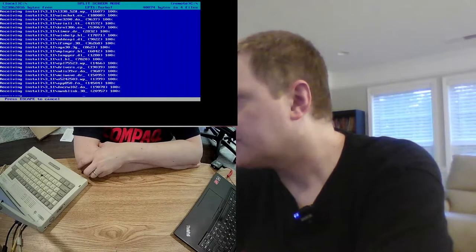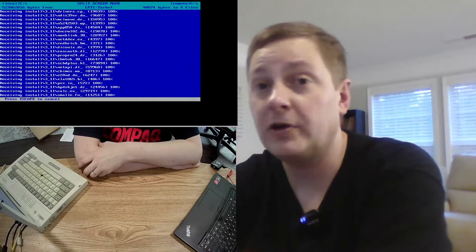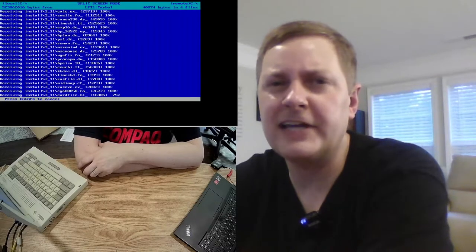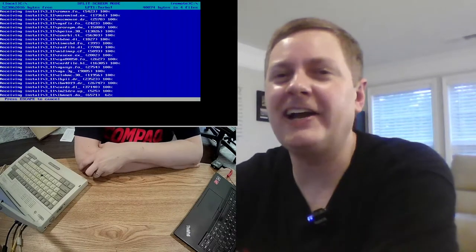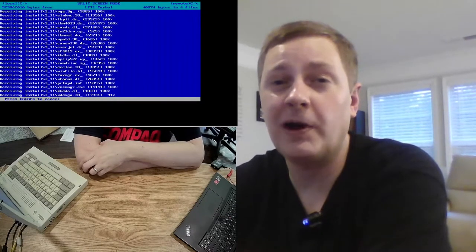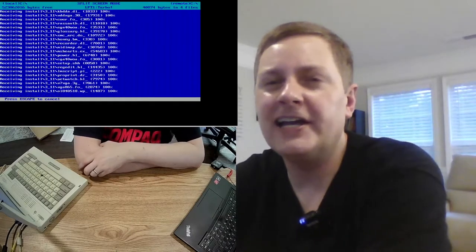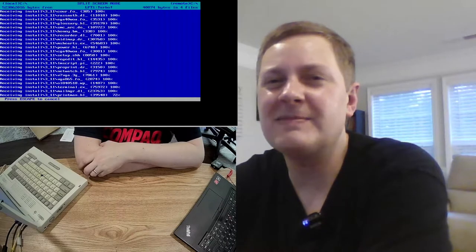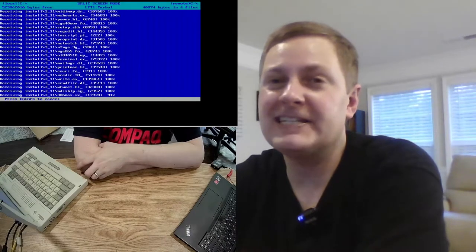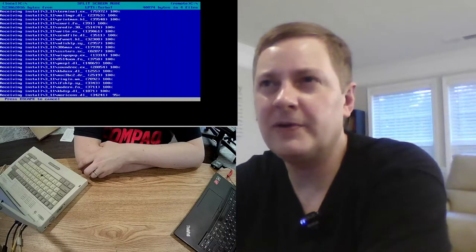So, yeah. Marco CS, trying to network an IBM PS/2E with DOS 6.2. I forgot how many options were available with protocols. Oh, yeah, tons. I think I have a setup video on LANtastic. The key thing that I found with LANtastic in setting it up was that you had to connect into a wired network because of the way that VirtualBox simulated packets. It seems to work well for IP packets. It doesn't seem to work quite so well for LANtastic. As soon as I figured that out, which was an act of frustration, I got that working. So that's one way to do it.